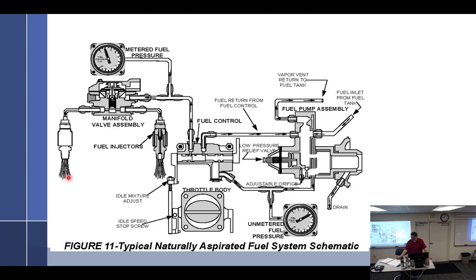I have about half a page of notes on how much fuel and air is needed for an IO-540 — that's a six-cylinder engine running at 2500 RPM. It requires roughly 1,020 pounds of air per hour, and about 15,000 cubic feet of air.